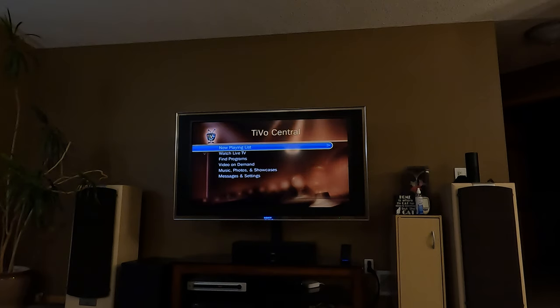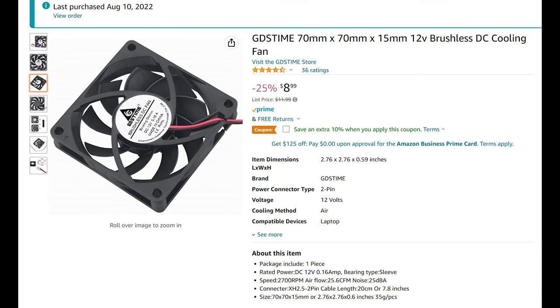As you just saw and heard, the TiVo Series 3 is successfully powering up after replacing the fan. Keep in mind the connector on this fan is technically not the correct connector type, however it does fit securely onto the two-pin connector on the motherboard of the TiVo Series 3. I'll put a link in the description to this fan on Amazon, as well as information about other fans people have recommended on various forums. If you found this video helpful please consider giving it a thumbs up. Thank you for watching, and I hope you can use this video to successfully replace the noisy fan in your TiVo Series 3.